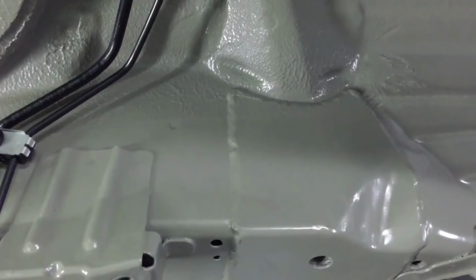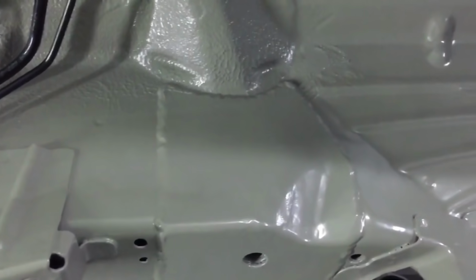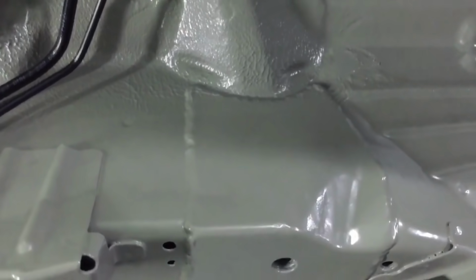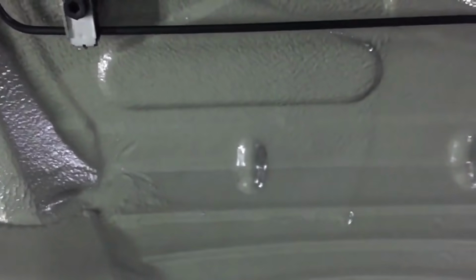So this gives you a nice example of the sprayable seam sealer that we've applied and spent a decent amount of time masking and soft edging, so that rather than just spraying on and landing anywhere, we're trying to replicate the factory finishes. We obviously go on about that quite a lot, but that's the point of this whole build. It's a replica of what it came like from the factory. This is some of our sprayable seam sealer across the top of our reinforcement plates there, to join up with this front edge where they sealed it from the spot welding marks up at the top. And we've got sprayable seam sealer on these joins here, where the rear axle carrier panel joins the seat panel. And this is our sprayable seam sealer as well, where the rear seat panel has a reinforcement.